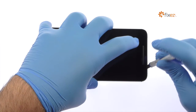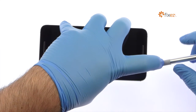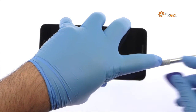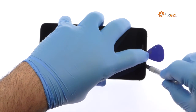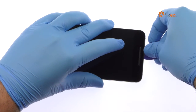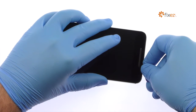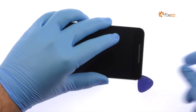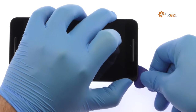Use the Precision Knife to create space and insert a plastic triangle opening tool. Use the triangle opening tool to release the clips and pop the Nexus 6P out of its rear enclosure.